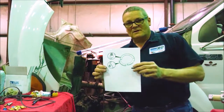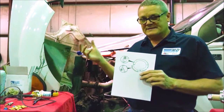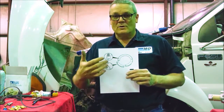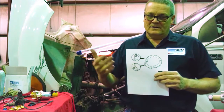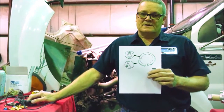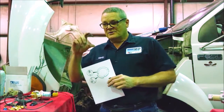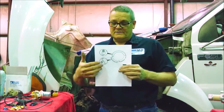We also know that all bolts and fasteners can fail. This is the tone wheel bolted to the crankshaft on these ISBs that have a crank sensor. If this piece falls off — which occasionally they do — you're going to lose your crank sensor signal. Sometimes you'll have to take the crank sensor out, bar the engine over with a mirror, and look down in that hole to make sure the tone wheel isn't missing any teeth. Or, as you're turning it by hand, you'll see a section where there's no voltage movement — that's a clue you've got a damaged wheel.